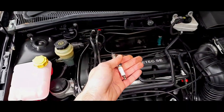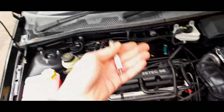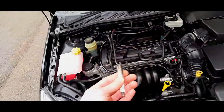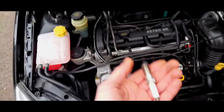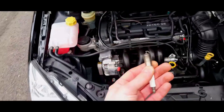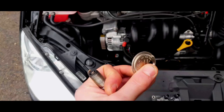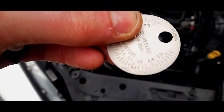If you've got the new coil pack, you can run 1.3 millimetre spark plugs. If you've still got the original, you need to run 1 millimetre spark plugs. Whatever spark plugs you buy - NGKs are fine, like the ones I've got here - do not trust pre-gapped spark plugs. In my experience they're wrong half the time. You'll need a spark plug gap tool - they cost about £2 from the motor factors. I'll show you: one millimetre. If it slips past the 1mm marker, it's too big.